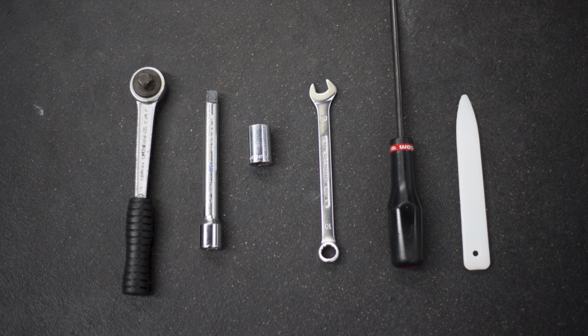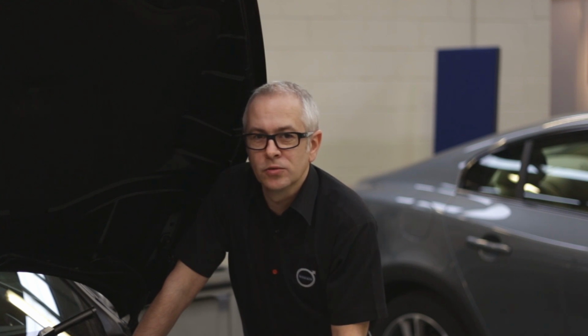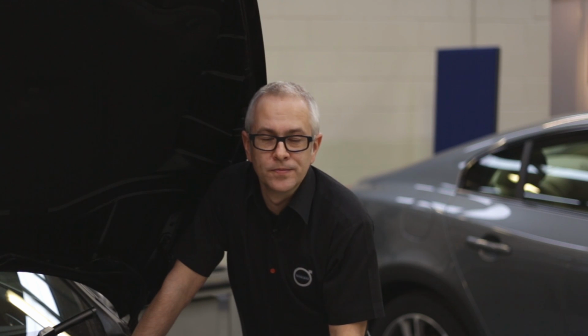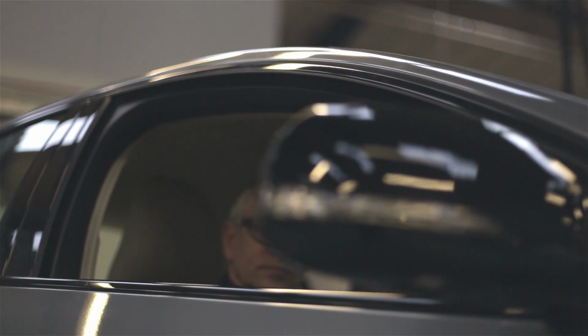Next thing you need to consider is, do you have the correct tools to do the task? Usually a good selection of hand tools will suffice, albeit that we may need Volvo's diagnostic equipment to go into the vehicle for calibration of stop-start and battery monitoring sensor, for example. Other things that may need calibrating, such as the clock and one-touch operation of the windows, need to be considered.